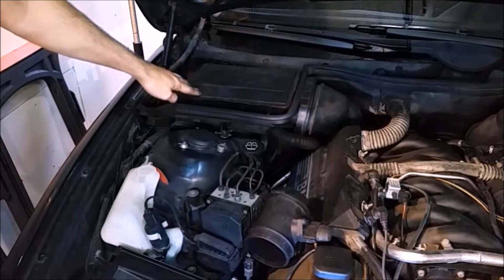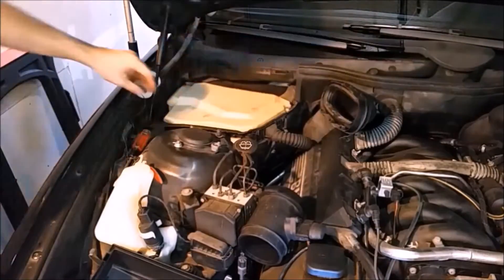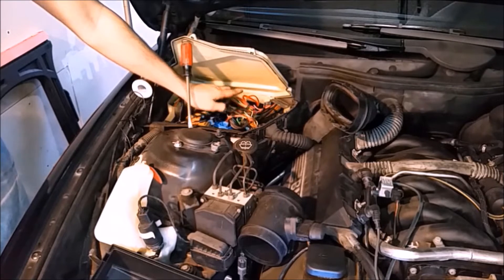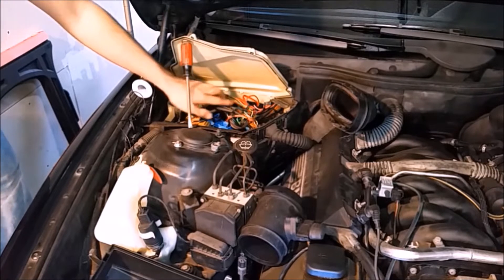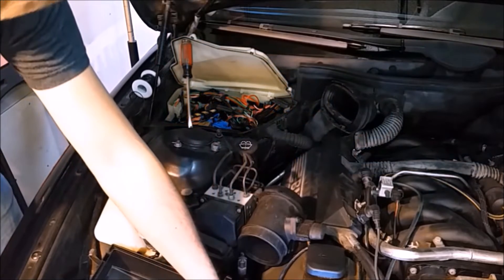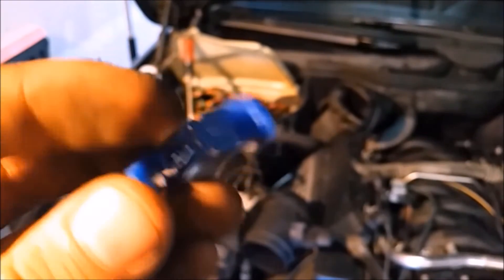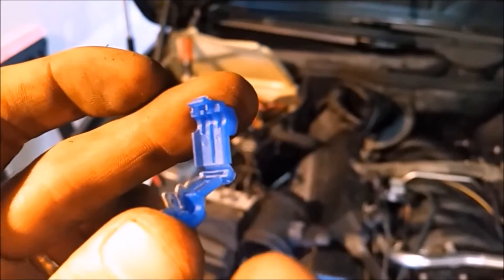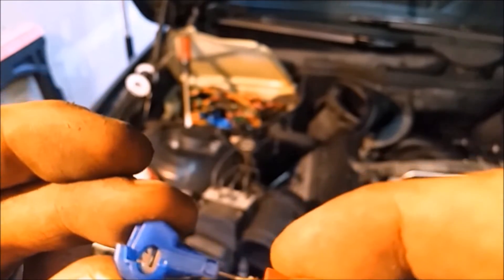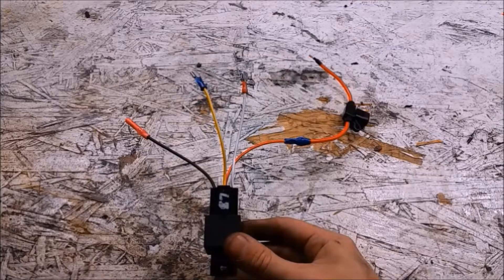To wire the fan in, we're going to have to get to the fuse box here. With the fuse box open, we're going to be tapping into the green and white wire for our switched 12-volt and our red wire for our battery power. The fuse box area is also where we're going to be putting our relay and fuse. I've got two wires running down the engine bay — one is going to go to the thermo switch and the other is going to go to the power on the fan. For the switched 12-volt we're going to be using this type of splice clip — once I splice into the switched 12-volt with this clip I can close it and then slide a blade connector in, and that is what's going to make our connection.